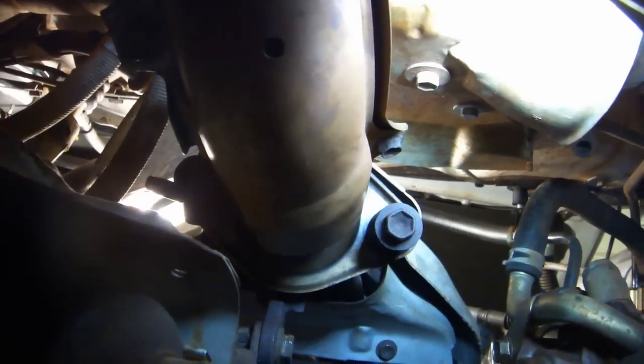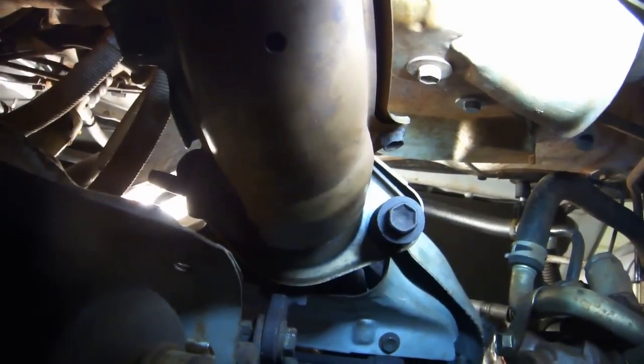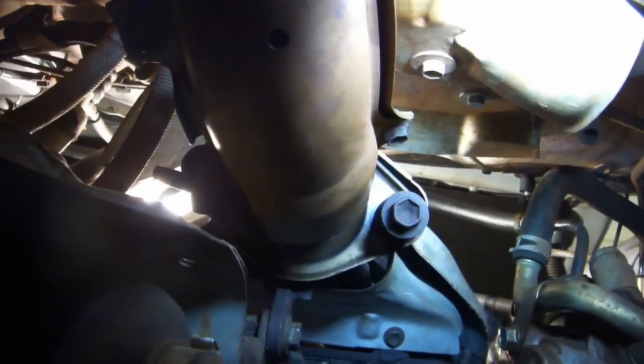Replace the 2 bolts. Use a 14mm combination wrench to alternately tighten both sides. These 2 bolts turn relatively easily, except for the springs making a bunch of noise, right up until the point that they bottom out, and then you'll hit your torque limit very rapidly.